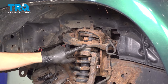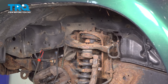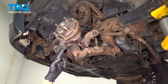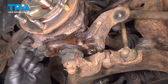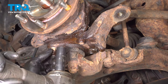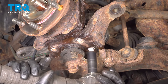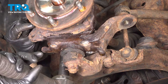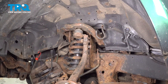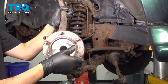Take a hammer and tap the control arm right here. Now to remove the lower ball joint, you can just unbolt these four 14mm bolts and it'll separate right here — the ball joint can stay attached to the lower control arm. Now take a pry bar and pop it free. Lift the knuckle up, take off the upper ball joint nut, then push the axle through and take the knuckle off.